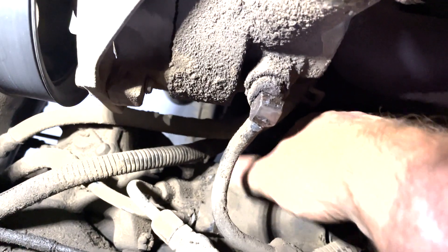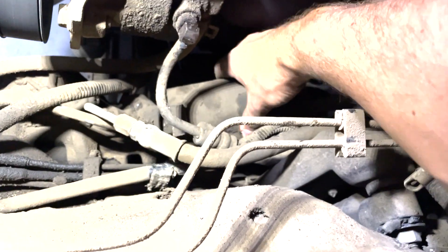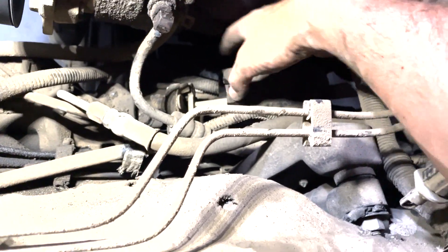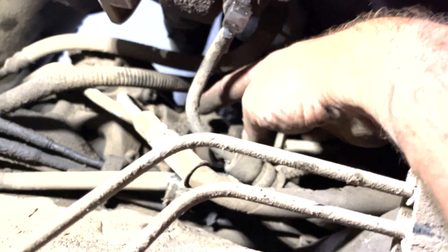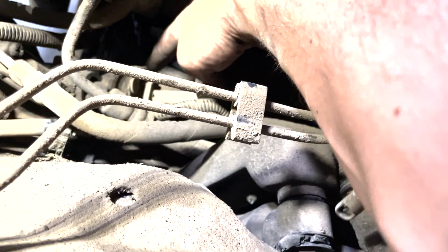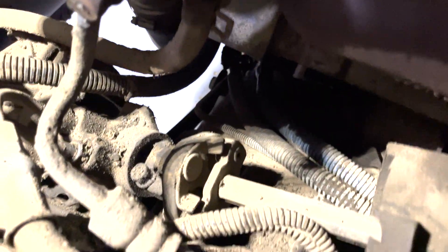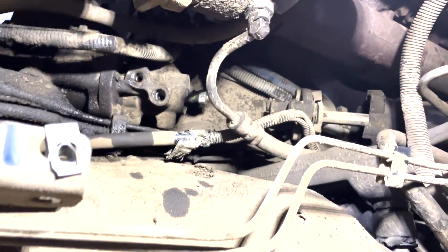The first step to taking off these two power steering lines — you've got one right there and one right here — is to pull this plastic shroud back. Try not to do what I did: this little clip right here clips onto the hose and holds it in place, and I was a little too violent and it just snapped right off. That's supposed to go over this steering connection and keep it from getting tangled in any of these wires. Unfortunately that's broken now, but it should still go back on and be okay. Now we'll pull off those two power steering lines.